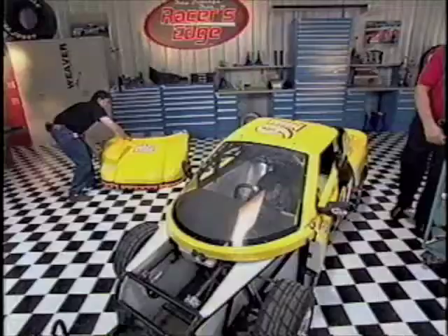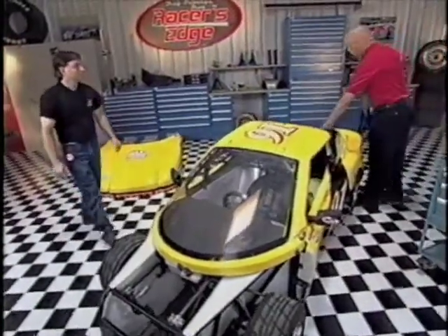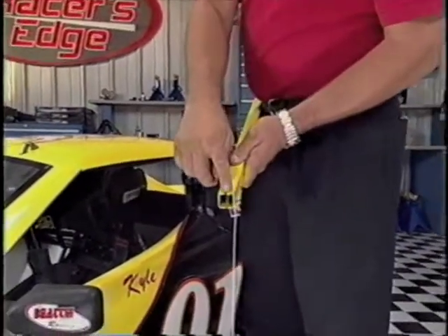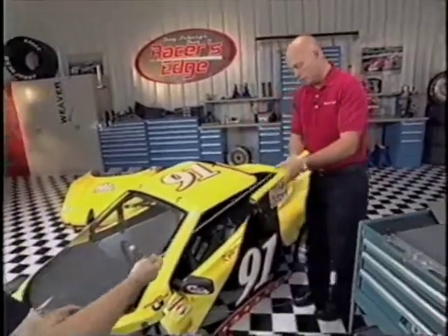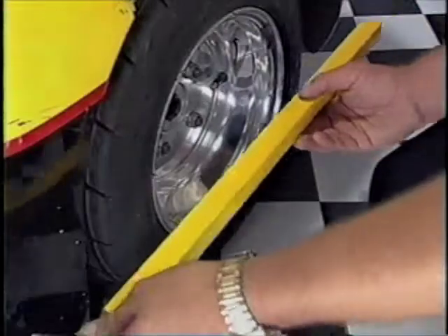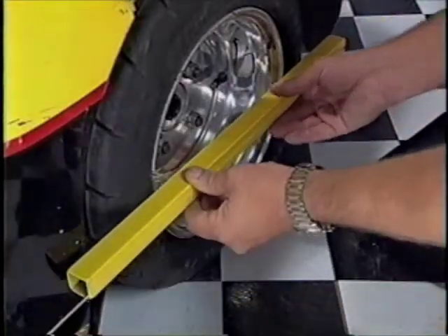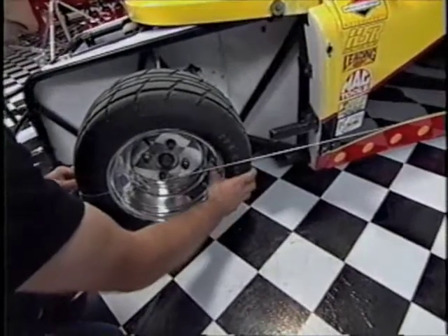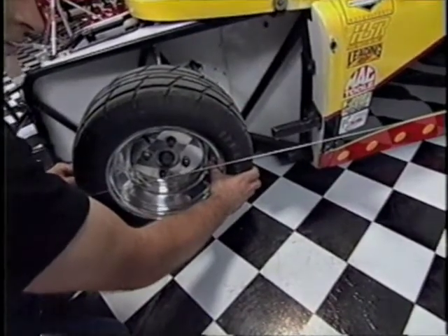What we want to do here, Tim, is we're using this piece of square tubing — it comes in real handy. We've got a slot cut here in the end of it, we've got a string added to it. Tim, I'll let you have that end and I'll take this end, lining up on the vehicle back here at the rear. What this will do is give you a perfect parallel way to line up that front tire.